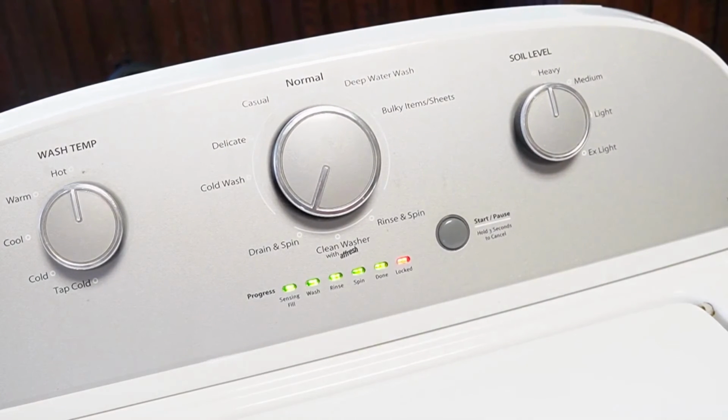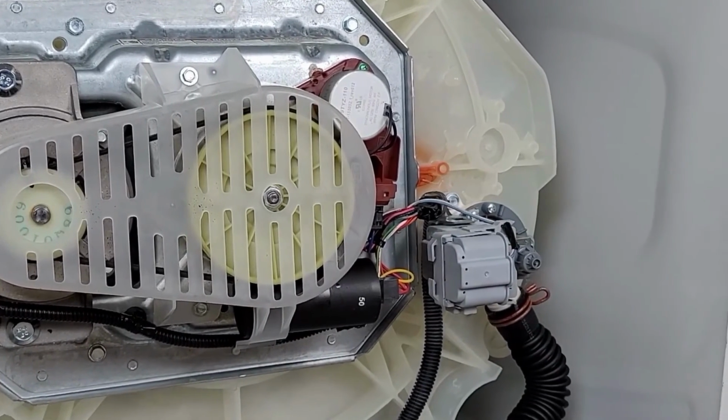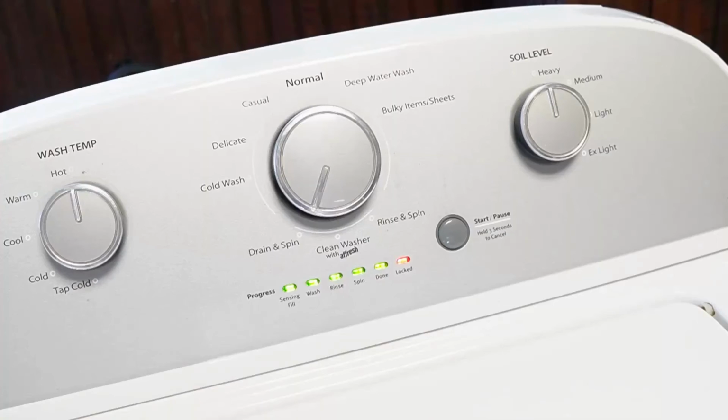As the recalibration mode runs, every part and process on this washing machine is going to be run, and the machine will physically reset all the components to a default state, allowing them to run at an optimal level. This is a must-have when parts aren't working right, or the machine just doesn't know what state the washing machine is actually in, like you've replaced the shift actuator or even a control board. During this time, you're going to hear all kinds of noises from the machine, and that's going to be totally normal during the approximate 3 minutes. Now, when the calibration mode is at the end, every single light is going to turn off, including the lid lock light, and the machine is now ready and recalibrated for use at an optimal level.